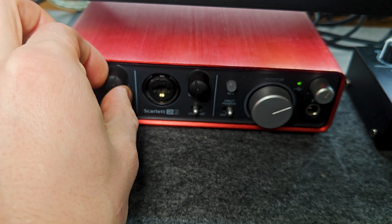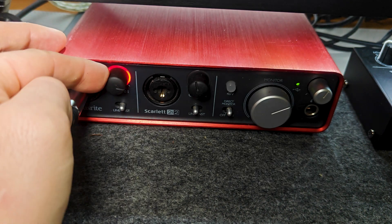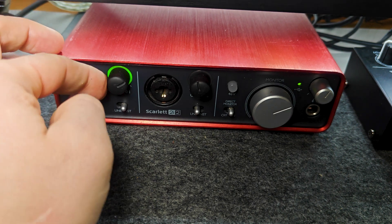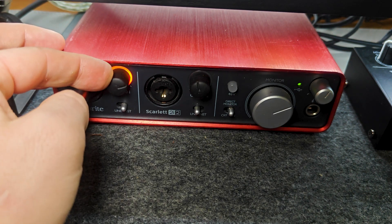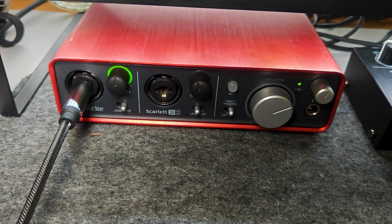When recording, also try turning the recording volume controls. If there are any dips in the sound, then they should also be replaced. Their level of serviceability can be determined by turning the regulator to the maximum — if the recording volume level is too low, then it is worth replacing the control.